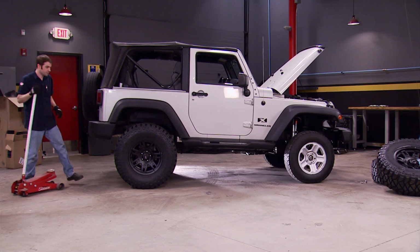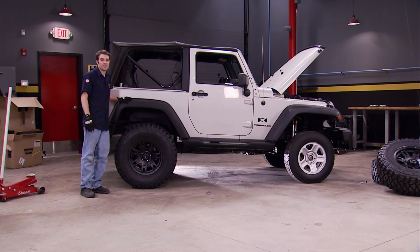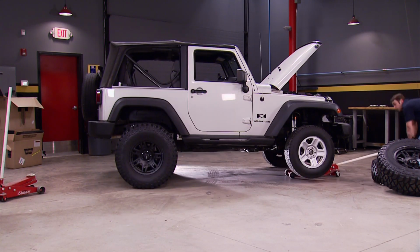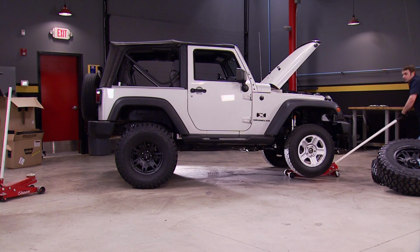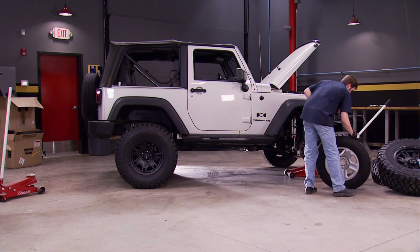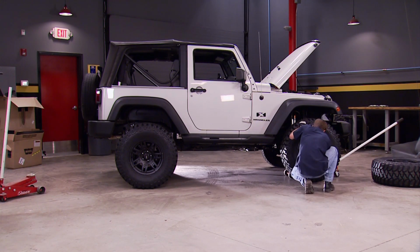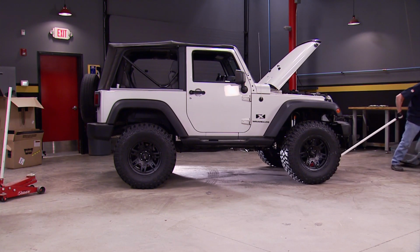Dragster style? Yeah, I didn't think so either. The wheels we've got those tires wrapped around are Mickey Thompson Sidebiter 2s in a 17/9 size with 4.5 inches of back spacing. The aluminum wheels look good, and they've reduced rotating mass and unsprung weight.